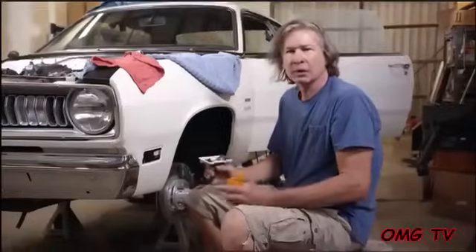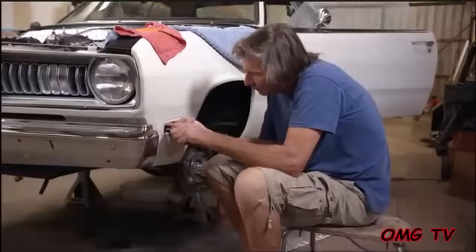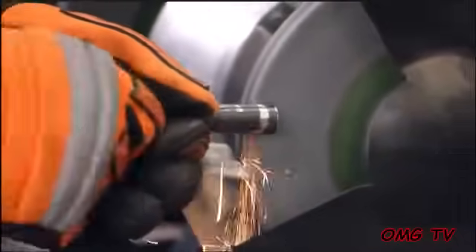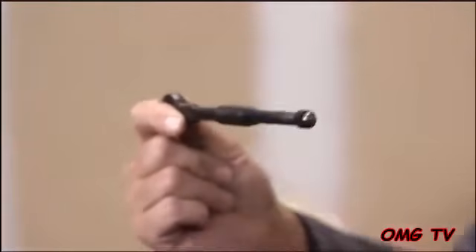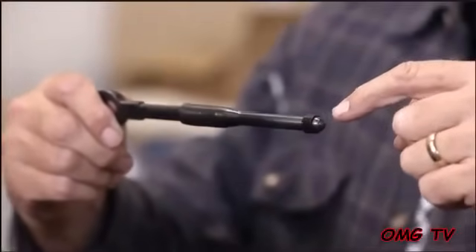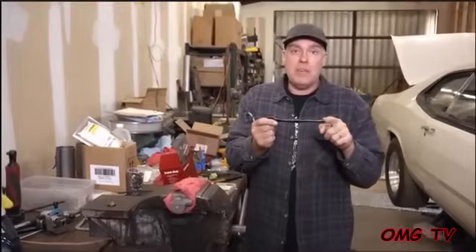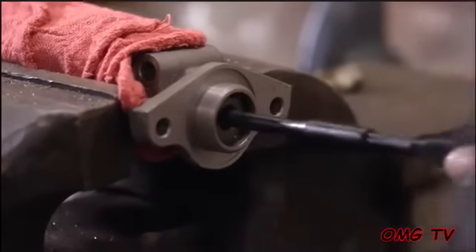I made a mistake when working on the side marker assemblies on the bench — on the front of the Duster, you can't put the lens in until the housing is actually bolted in the car. I had to remove the lens, which is a little tricky, but luckily it came off without breaking, and now I'm putting it in the right way. I'm also having to grind down the outside diameter of the pushrod because it rubs on the brake pedal. The pushrod story is coming to an end — I had to shorten the threads, shorten the body, and cut down the OD so it didn't hit a bracket under the dash. I decided I'm going to have to go with that other master cylinder that was machined for the rubber doohickey. Watch how this thing pops into the bore and retains the pushrod — boom. Now it's retained and won't come out.